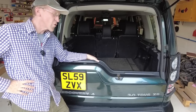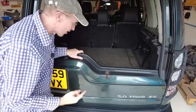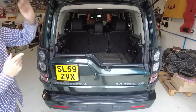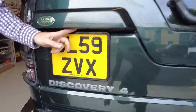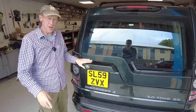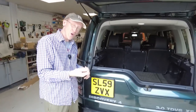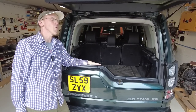But when they go wrong, you're in all sorts of trouble. The upper tailgate has its clasp located in the lower tailgate, so the upper tailgate release is actually inside the lower tailgate. If you come to your car and nothing happens, sometimes it's just the switch - we've done a video on replacing that switch. On early ones there was an aluminium paddle that got corroded. You can also press and hold the tailgate release on your key fob.